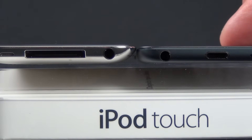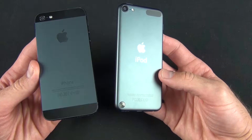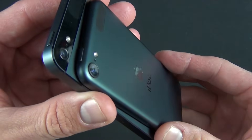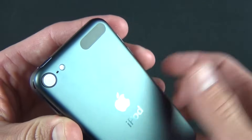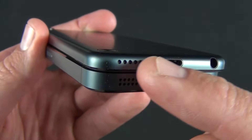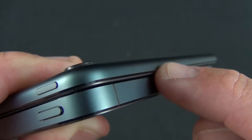The iPod Touch 5th generation is slightly thinner than the 4th generation, yet offers more hardware, more features, a much better screen, and a thinner form factor. It's the same size as the iPhone 5 with a very similar slate anodized aluminum finish, though the iPod Touch has a more rounded unibody design versus the more angular iPhone design. The iPhone feels like a higher quality build — for example, glass RF transparency windows versus plastic on the iPod Touch. Along the bottom and sides, they share a very similar layout for the lightning connector, headphone jack, speaker cutouts, and polished chamfer-edged buttons.